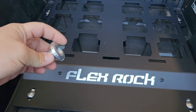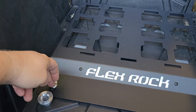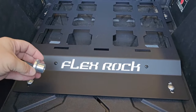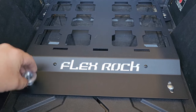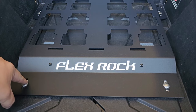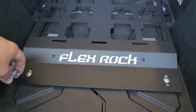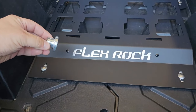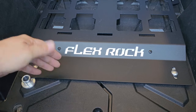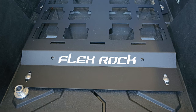The other thing you're going to see is this special bushing that comes as part of the hardware kit. This drops into the bed and allows you to bolt this to your plastic bed without collapsing that plastic boss in the bottom. It's just the right length to drop in so you can tighten this up nice without distorting or cracking that plastic boss. It also has a standoff that keeps this thing up off the machine bed just enough so dirt and debris can get washed out.